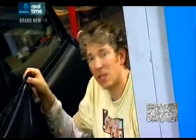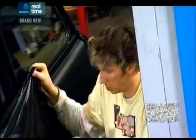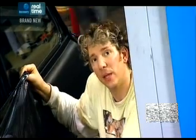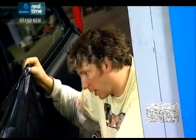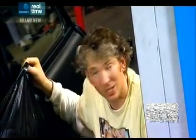So what the heat gun does, effectively, is it relaxes the material, so it goes back to the size and the shape that it was originally made in. So all those creases and dings I've just put in then get worked out, which is fantastic. So then if I leave it a little bit, it cools down, I can then reapply it. And hopefully, with James's help, we're going to rescue this side. Thank you, sir.